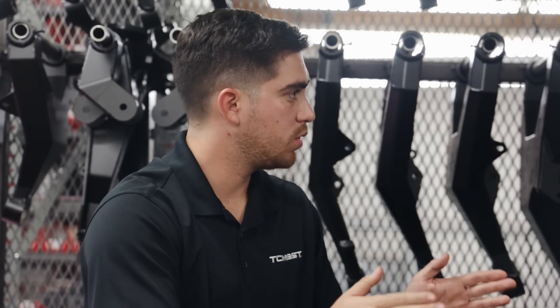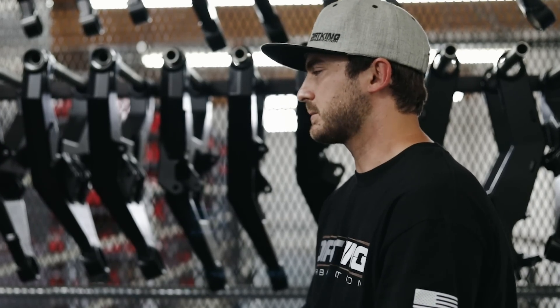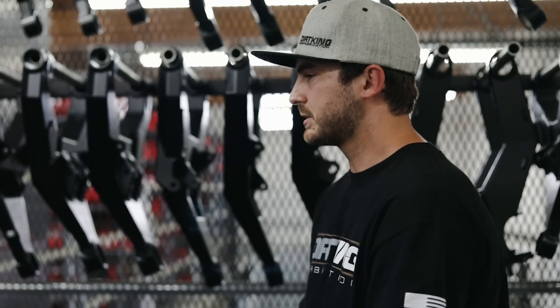I don't really need long travel for the third gen because that's not the route we're going — I want stock length overlanding, being able to squeeze through the trails. Correct — so with what you're trying to do, this setup is perfect for that application. It's a stock width setup that allows more articulation, you get additional down travel with our upper control arms, and you also have the correct geometry built into the upper control arms. For what you're trying to do, this is the perfect setup. With long travel it may not be the best case because you're not doing high speed, and some of the trails you're going on may be a little tighter where you don't want the additional track width.